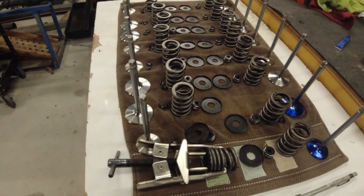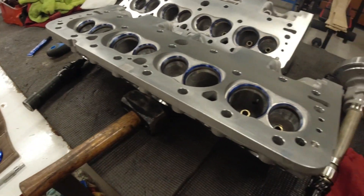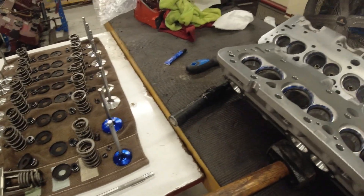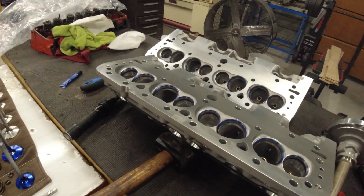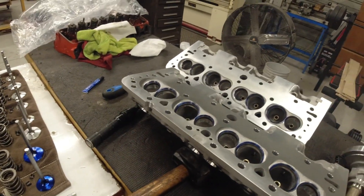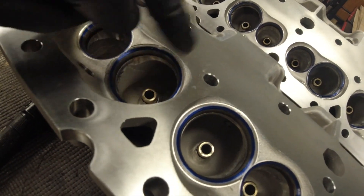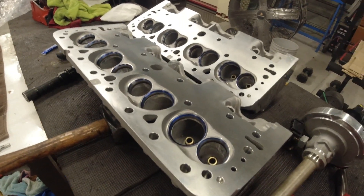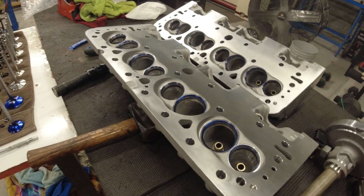I feel really confident that this set of heads is well within tolerance to run without any problems down the road. I just wanted to put this video out — I'm not trying to tell people what to do or act like I'm any kind of an expert. I'm learning as I go, and maybe I'm totally wrong doing it this way. But I can't see how they could be off enough to cause problems when they're marking that well all the way around. I'm a machinist, I'm used to tight tolerances. If there was an issue with eight to ten thousandths, you'd see no bluing at all on one side of the seat. So I feel confident with mine, though it might not be the same story for the next set Edelbrock sends out — it's definitely something to keep in mind and check before installation.